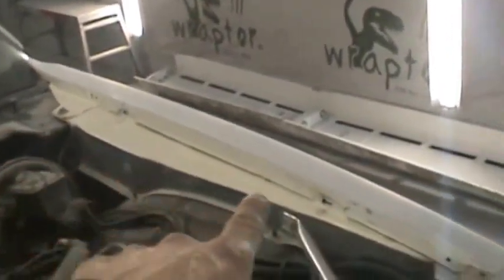I caused a run on the mirrors because I got overzealous, but the mirrors are hung up there right now. Jeremy's cleaning up the paint booth and getting it ready. We're gonna get this up on stands, prep up that door hole — this has been taken down to 400 and it's ready for sealer.